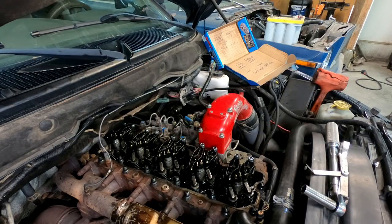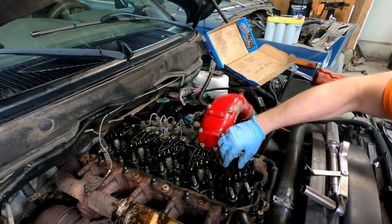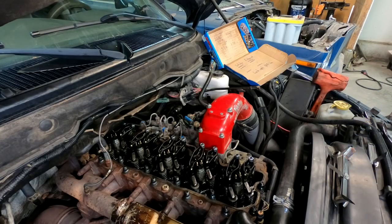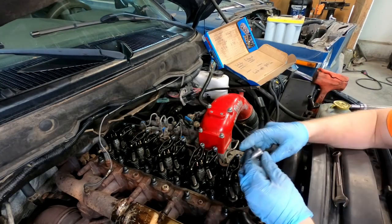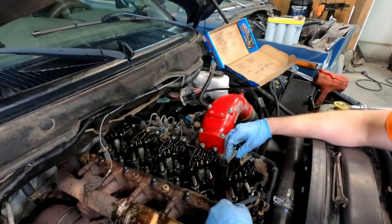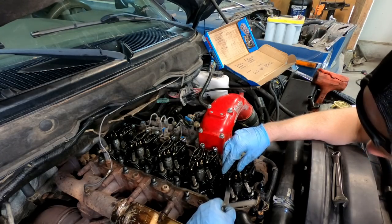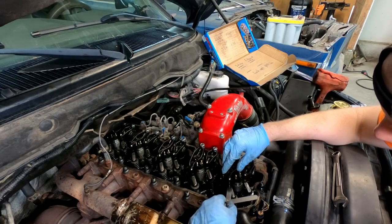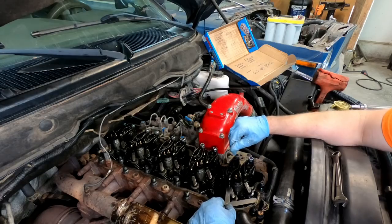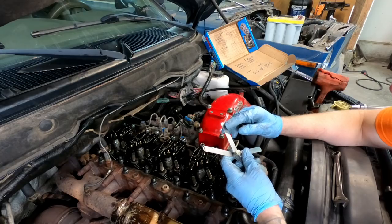According to our chart we can do the exhaust side now — let's see if that's within our allowable tolerance. We try fitting the 0.030 in there — yes, very easily. I think that might be a little too loose, so I'm actually going to readjust this one as well and bring it down to 0.020.